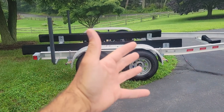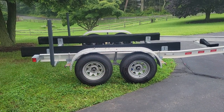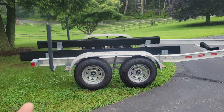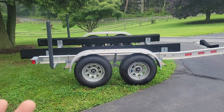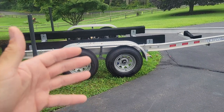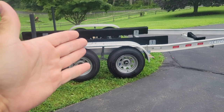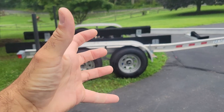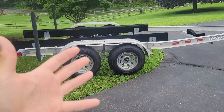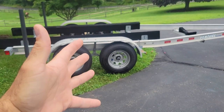You could feel the heat just by getting close to it. Let it cool down, took off the tire — the hub wouldn't turn at all. I was like, did I seize up the bearings? I didn't know what I did. I took a hammer and tapped the brake caliper and it released, and then I was able to spin it. So I'm thinking the caliper froze.